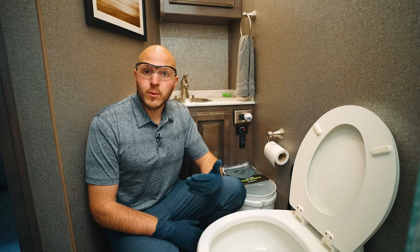Make sure your water pressure is drained out of the system — nobody likes a mess. Next, grab a 5/16th nut driver. Along the back, there's a large hose clamp — loosen the hose clamp. These are two half clamps; you slide them out of the way. You'll want to get yourself a little rag — you might have a little bit of a dribble. In the back, there's something called a vacuum breaker. You have to wiggle that out — it can be a little difficult, so just keep going left and right. Once you have the toilet free, pick it up and gently put it on the side.